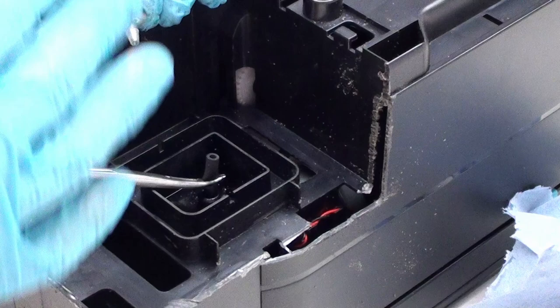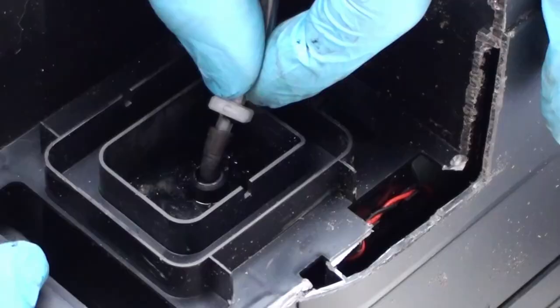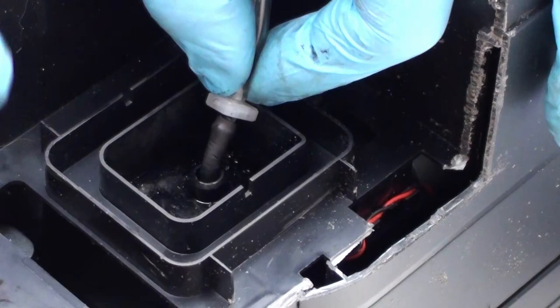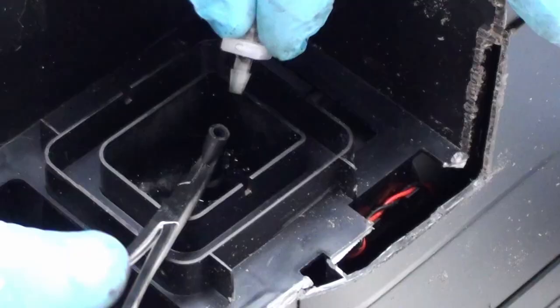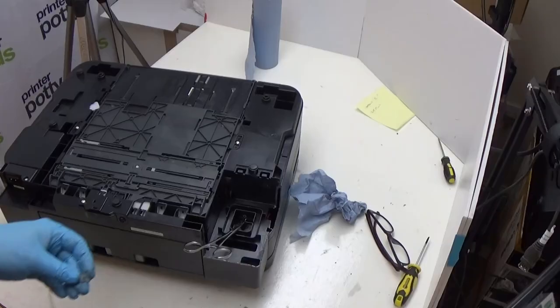You want your connector to go in approximately toward the top of the barb. If you can get your fingers into that gap that normally exists there, then by all means get your fingers in, hold the tube, and push the connector on like that. If that's an option, do that every single time. But if the hole is too deep or you can't get your hands into that space, then use your forceps as a brace to get it most of the way in so that it's splayed out the tube — that's the best point.